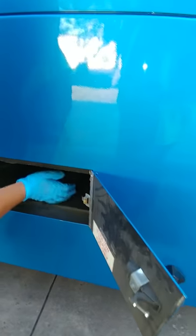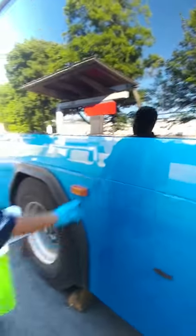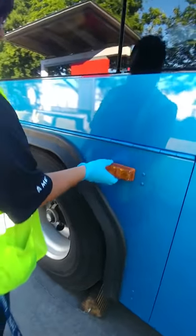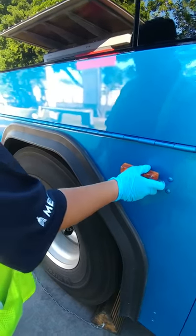Here, you want to check your fuel. Make sure the cap is present, secured on tightly, and it's free from any leaks. Got another side turn signal — make sure it's free from damage and properly mounted and secured to the side of the bus.